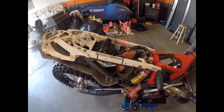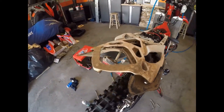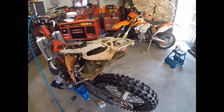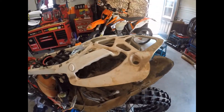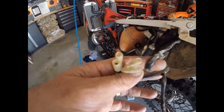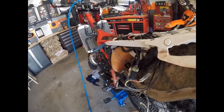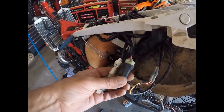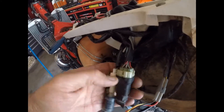So I'm in the process of basically two things: taking the bike apart and learning where everything goes — this is my first Beta, a 2017 300RR. Unlike my KTM, which I completely rebuilt, this is a new-to-me bike so I'm learning as I go. The blinkers were totally shot — there was actually water coming out of the receptacles, and the wiring going to the blinkers was completely shaved off. The previous owner did put dielectric grease on the fittings. I've since taken them all apart, cleaned them, contact-cleaned them, and added just a touch of grease.